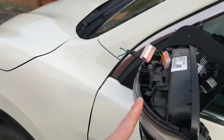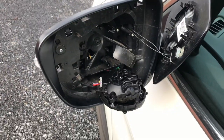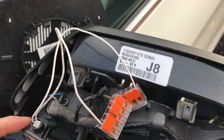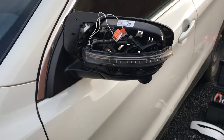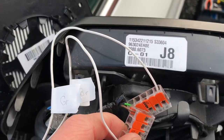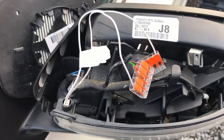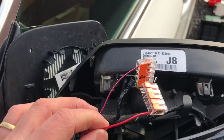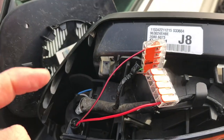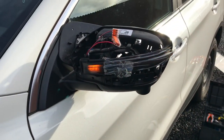Removing the indicator itself is really easy — just unscrew both screws and it should come off. As I told you, I wanted to test if this new homemade connector worked as it should, so I connected it quickly like this. As you can see, it does work. Both wires are similar, and they should be connected to a green and a brown wire, so I labeled them. I tested first because I thought the red wire would go to green, but it is the other way around — red goes to brown, and black goes to green.